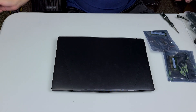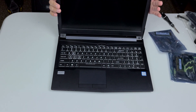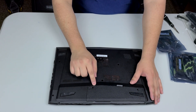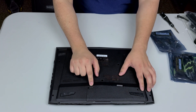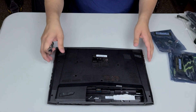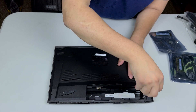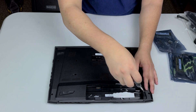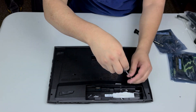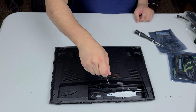These Clevos are actually made to be pretty easy to work on. We're going to turn this one around and unlock the battery — it has a little unlock symbol, unlock it again, and just lift up like this. Very easy. Now we're going to take off three screws from the back here, and then remove this screw that's also under the battery.